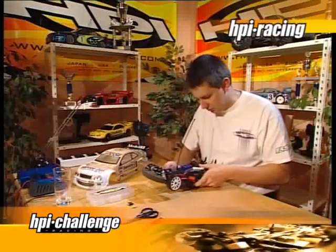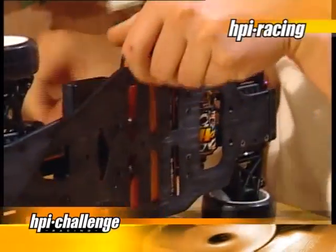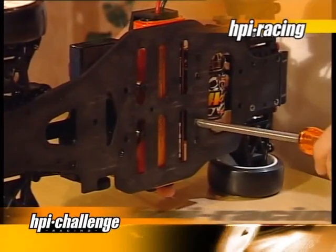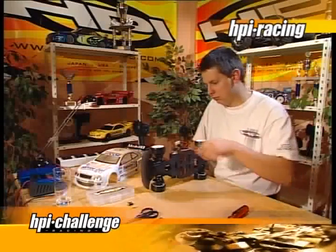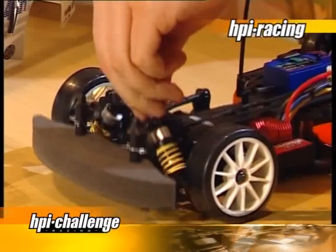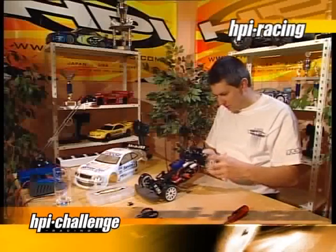Just like in Formula 1, preparation is necessary to make everything run smoothly on the racing day. The first thing to do is check the car. Make sure that all the screws are tight and that no parts of the motor mounting are loose. Also check the transmission runs smoothly. Remove the motor or the pinion gear to do this. All four wheels should turn easily now.